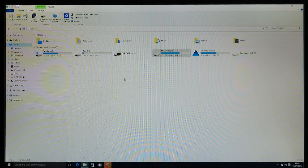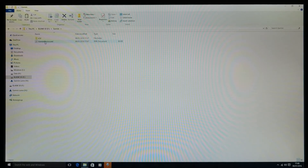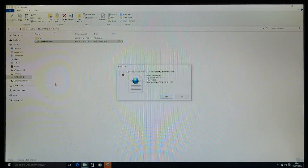You'll know if it worked because you go into Settings on the Zumo, go to Maps, click on Installed Maps, and on there you should see the map set you've just put on the SD card — the ones downloaded from Garmin Express. If you can see them, there's just one last thing to do: take the SD card back out of the Zumo and plug it back into the computer.